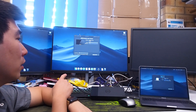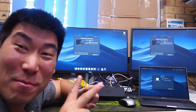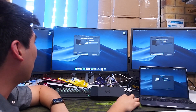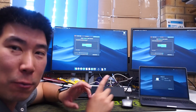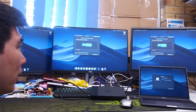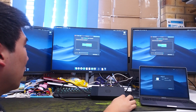Without any drivers installed, I can see one, two, three monitors detected already. But looking at the display arrangement settings, it looks like macOS is only able to extend to one external monitor virtually, even though it's detecting three. With three-monitor detection happening, it's a good sign we might be able to extend to three external screens, but at the moment it's only seeing one external screen in arrangement.